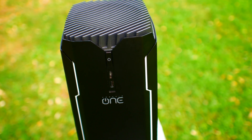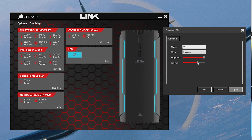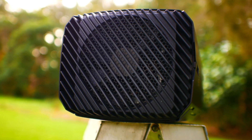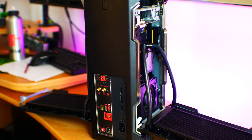At the front of the case there are two subtle blue LEDs — not RGB as you might expect — which can be set to breathing mode with different intervals or static mode with adjustable brightness via software. The sides of the case feature Triforce-style punch-outs which allow the radiators to breathe, and the top and bottom have thick metal fins. The top fan is a 140mm magnetic levitational fan and is one of only two fans in the One — the other being on the GTX 1080 or 1070 to cool the VRM and memory.